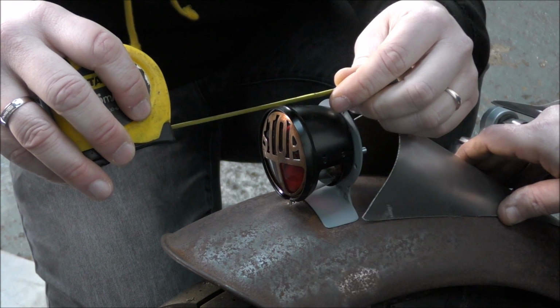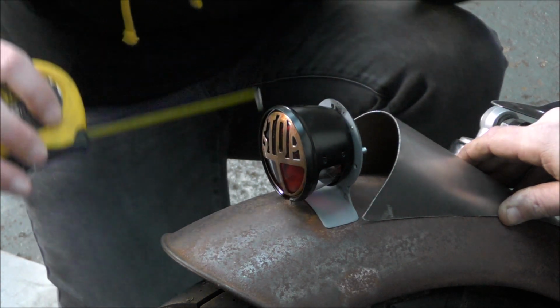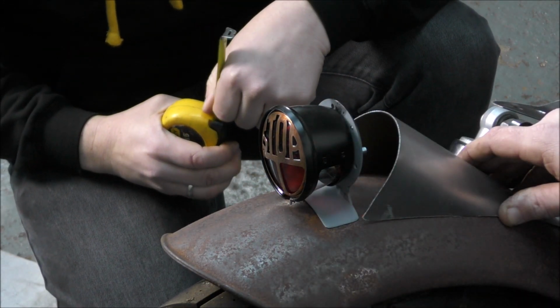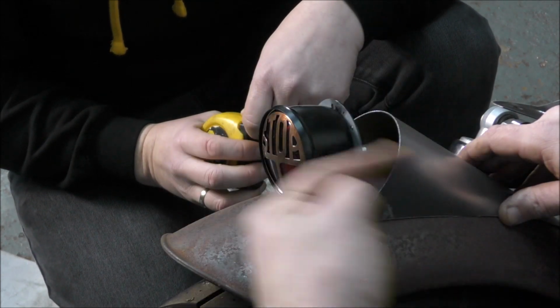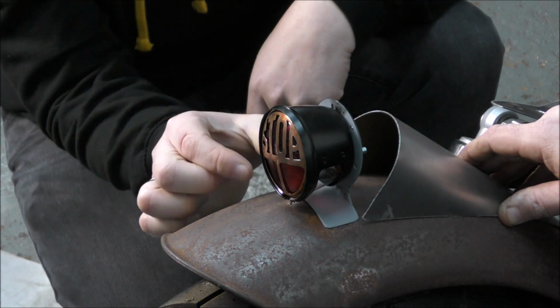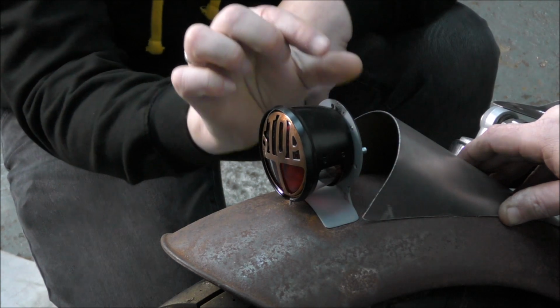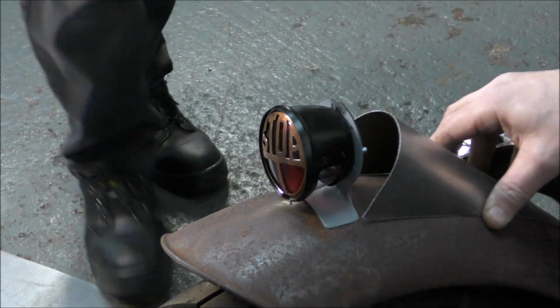In which case then the bit over the light is going to be 45, plus a rollover, so 50 by 100. Because that's the one we said, just make it 70. Okay. Because then we can make the rollover, curve it, and then trim the back off to make it the size we want. We'll do this bit first, get it in place and then measure the gap. Okay, so once we've rolled it and trimmed it, it'll be 50 by 100.